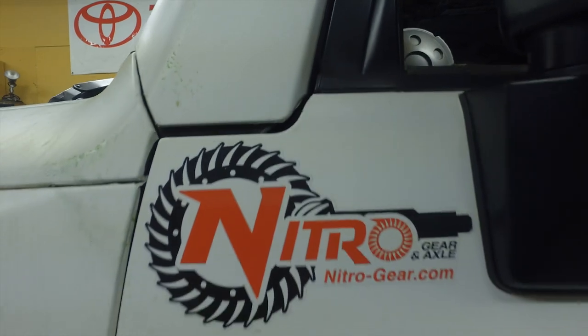Let's talk about gearing and your wheel and tire choices. I have re-geared — I'm running 4.88s from Nitro Gear. It has made a world of difference. I've been amazed at how I've got my mileage back up on the highway, but also the low gears and being able to go a little bit slower when I want to. Cruising speed and everything is a lot easier on the vehicle.